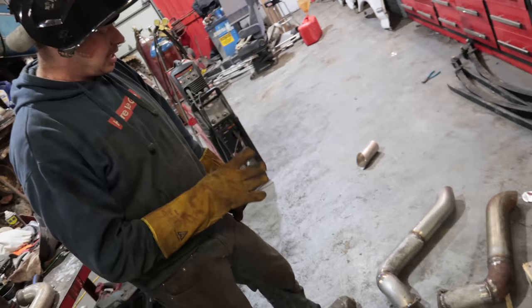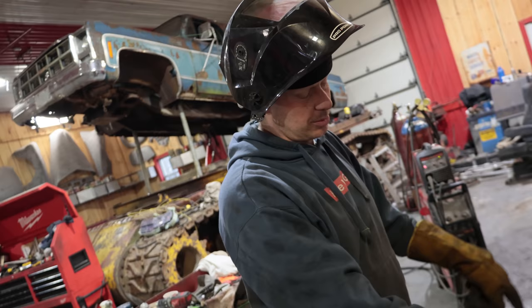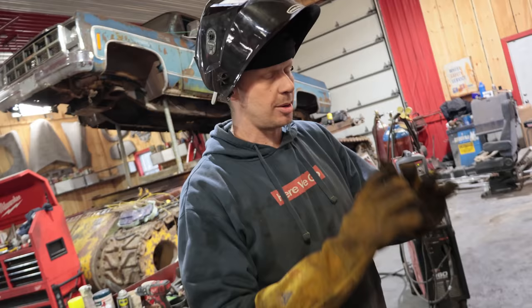The reason I did this for now is because we might want to turbo it later. If we're still underpowered, we could throw some 92 injectors in there and then I can actually swap them around side to side and rather than pointing out, they'll be pointing in and then I can put it up into the blower or the turbo that sits on top of the blower.